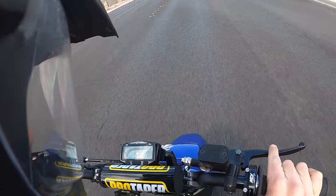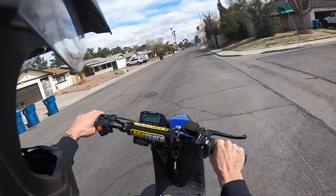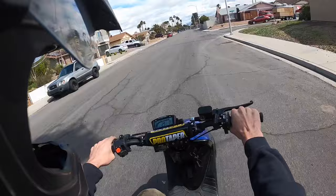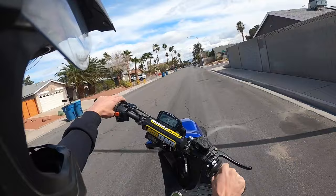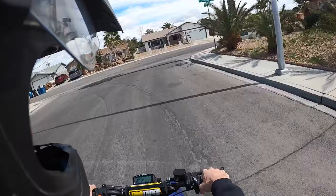So it changed a lot actually, it changed a lot. That's actually crazy how much it changed just in that contra. But I think it was hitting harder with the yellow contra in it. Yeah, I don't like it. It doesn't feel like, I don't know, we could lighten the rollers and really see, but it doesn't feel like it used to at all. Might have to stick with the stage 6 front variator, yellow spring in the back, call it a day. And then let's go ride.